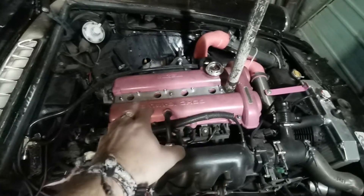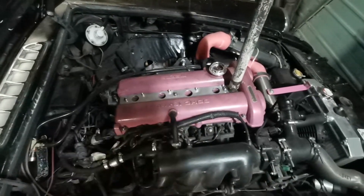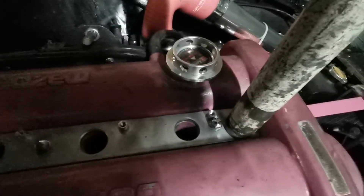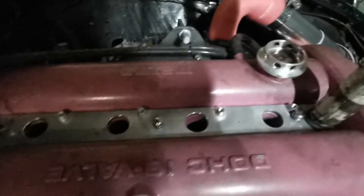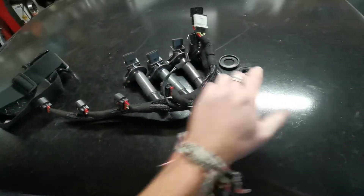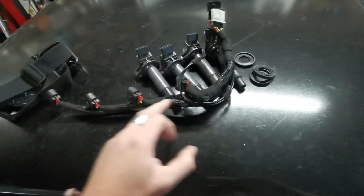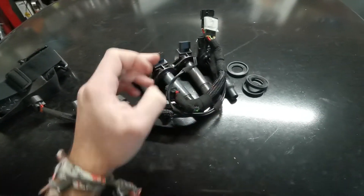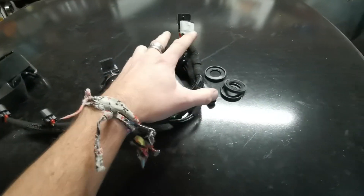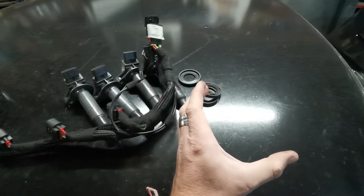For the normal Denso Toyota style ones, that's your bracket. If you're going for R8, they don't have a bracket — they don't need one, they are a plug fit. It just bolts down with the three standard rocker cover bolts. You'll get your four coils, your little donuts that go on the coil, and the wiring loom. Depending on how you've ordered it, if you want waste spark you've got the two connectors; if you've gone for sequential you get the two connectors and the breakout loom.